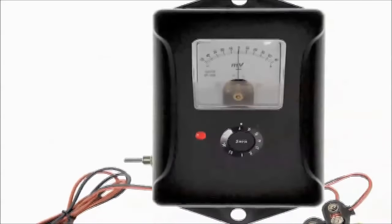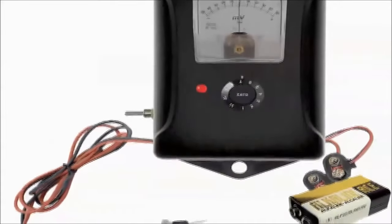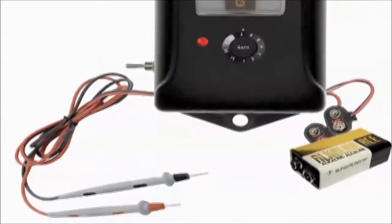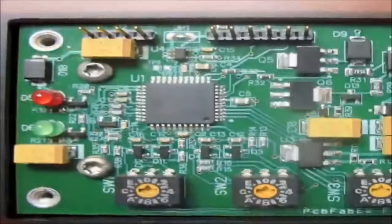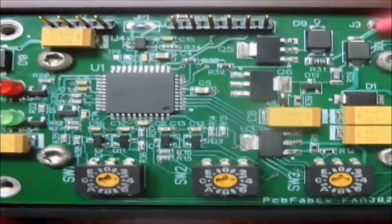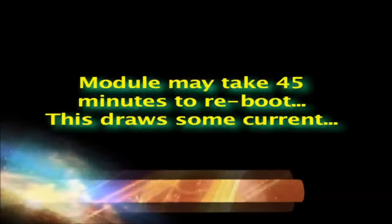The voltage drop short identifier is both a gadget and a research chart to be able to find short circuits in a modern automobile. In today's automotive world, you cannot disconnect and reconnect fuses and modules to find electrical shorts. Every time a module is disconnected, it'll do a reboot, which may take a long time to complete.